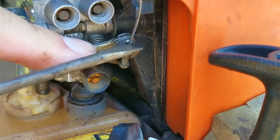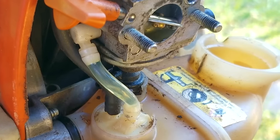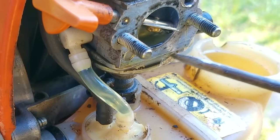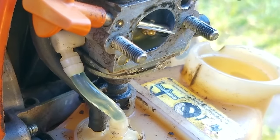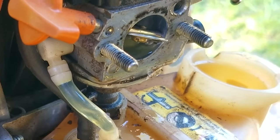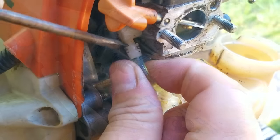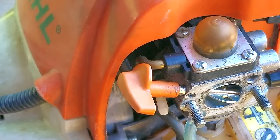After that, I'm going to disconnect the throttle cable and the fuel lines. While trying to figure out how the fuel lines were connected and pressing the bulb, I found out we have a very serious issue — the carb was leaking fuel, especially when pressing the bulb. Fuel is not supposed to be spraying into the carb like this when pressing the bulb. The main purpose of a bulb is to pull fuel from the tank and into the carb, eventually returning it back to the tank to make it easier to start the engine. It's not supposed to spray any fuel for this type of engine — it's different for lawnmowers and snowblowers, which are supposed to do that.